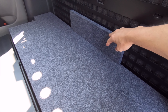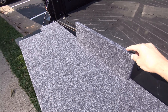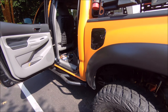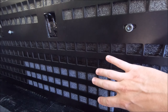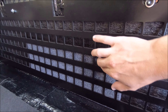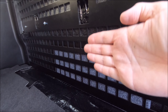I wanted to make it large enough and stout enough. I'll probably put three or four screws straight through this piece of wood into the similar piece of wood in the back, and that will hold it secure once the MOLLE panel is bolted down tightly. Here's a quick shot of the base with that attachment point attached to the back with a bunch of beefy wood screws. I have the other piece set behind the MOLLE rack — I decided to put it in front of the foam sound deadening material in here. It would look aesthetically better if it was behind it, but I didn't want to risk it shifting around. It is perfectly flush — it barely moves when I push it behind the MOLLE rack — and I do have this remounted with all the attachment screws. Next, I will get it in place and just screw straight through that first panel into this panel.